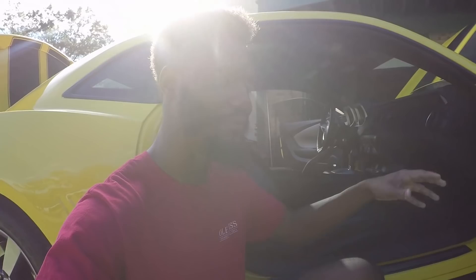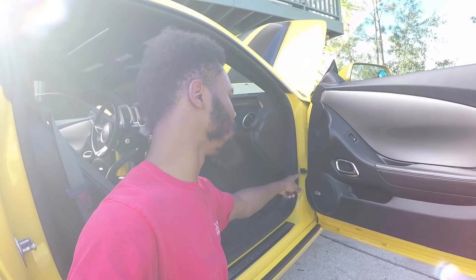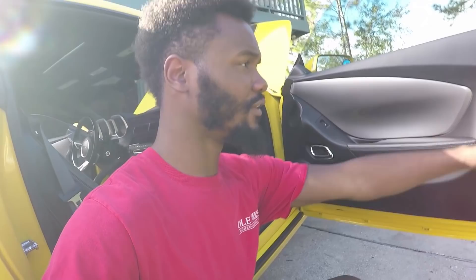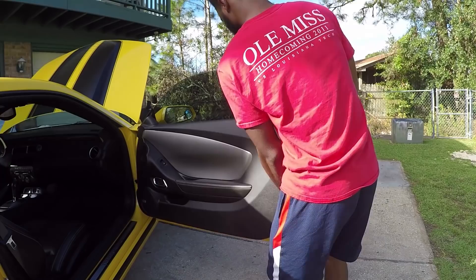We're tag teaming this so we'll be doing different stuff at the same time. I'm taking off the door panels because you have to get in there and take out your doorstop — you're not going to have that once you put the new hinges on and it would be in the way. To take off the door panel on the Camaro there are three screws around the edge, a screw behind the door handle, and a screw under the little handle. Once you pull those off, the whole thing literally just pops off. After I got the panel off, I had my nephew hold it in place so I could disconnect all the electrical connections as well as the door release.